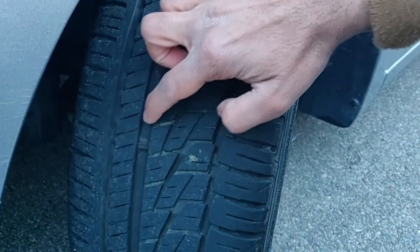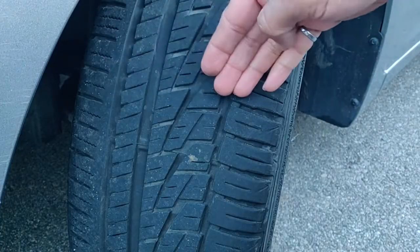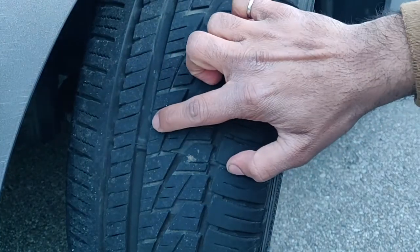And there's a different tread. See, there's just 1 chunk of rubber there. That's that right there. And on this winter tire, there is no wear indicator bar. And that's just the way it is. Not every tire has it. About 90% of the tires on the road right now, they do have it. But some tires just don't. And for this, you need to use the coin trick.